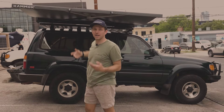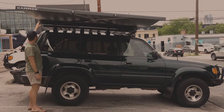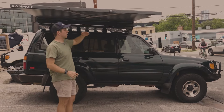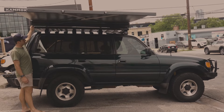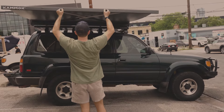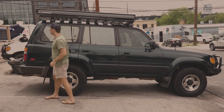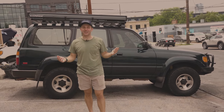In its most open position — say you're setting up camp — you'd take the ratchet, put it back in the lock position, and then to tighten up the awning fabric, just press up, up, up, up. That tightens the whole awning, tightens all the poles, tightens the fabric, and also raises the front face plate a little bit. That's how we typically set it up. Once you're ready to put it back away, take the same lever, unlock it, grab these same poles, over-pull it about four inches, and put it back away. For safety, always put it in the lock position, then go one, two little clicks up, and always click these back down.